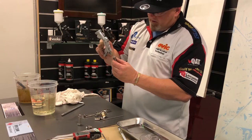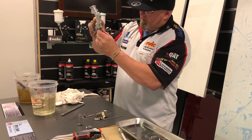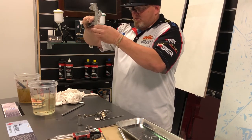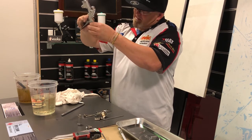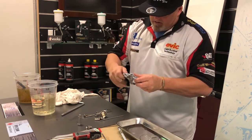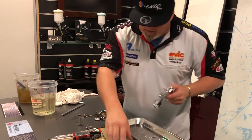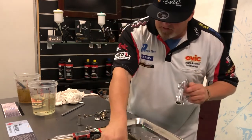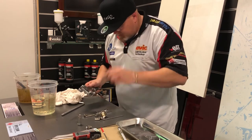This is the inner works of your trigger. Put it in like that — everything should go in quite smoothly. When you've got a spring, I always put my thumb on the bottom of the fitting because it's the last thing you want jumping across the thread. Just be patient and you'll find it. Really, really easy — and the more you do it the better you get. No power involved, just a nip up and you're good to go.